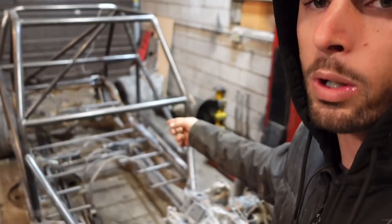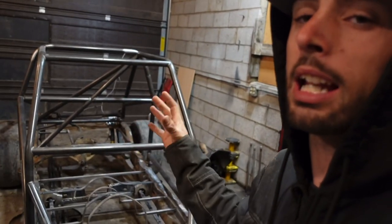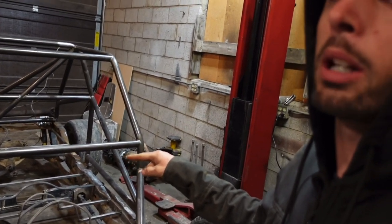we are going to be dropping the torsion bar crossmember, not necessarily in that order. I need to cut the welds off the torsion bar crossmember and drill and put some bolts into the frame so that I can remove the torsion bar crossmember. That way I'll be able to get the engine and trans out as one unit. So we're going to modify the torsion bar crossmember to make it removable again, and then we are going to paint the chassis and do a bunch of stuff. So let's jump into that.